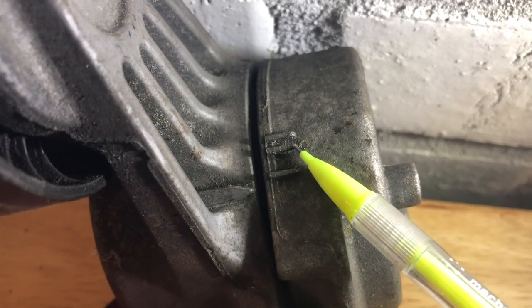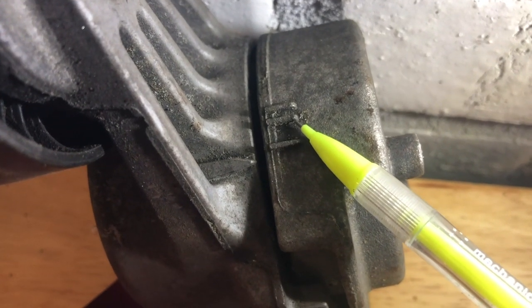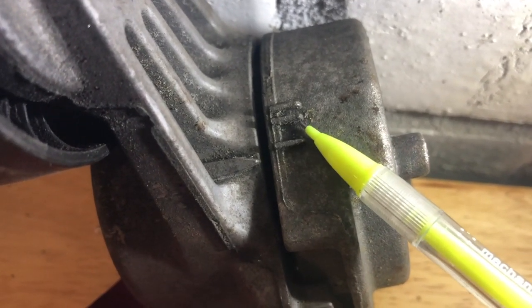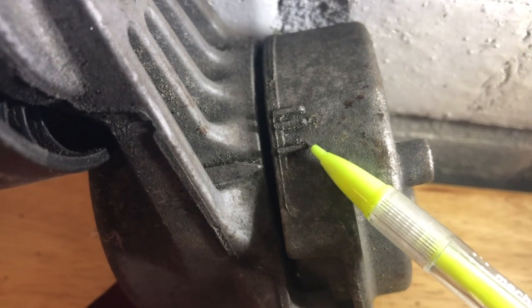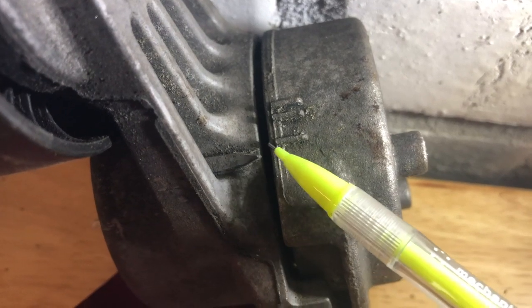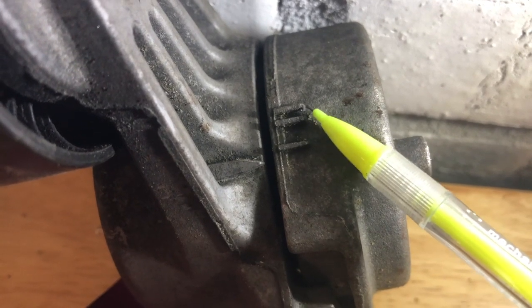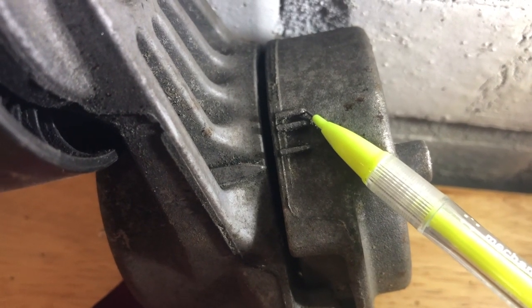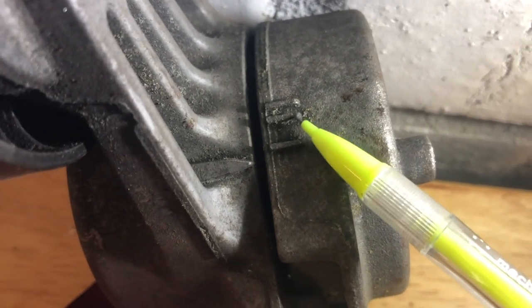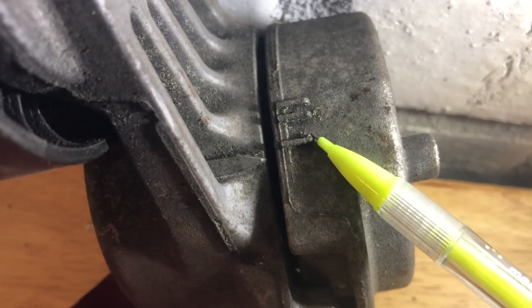When the pointer lines up with the middle marking, that's the 'please change me' marking. As it moves further over to the third mark, it moves from there to there faster — this is saying it's really stretching now. That is the absolute outside limit because the tensioner hasn't got much more travel before it drops the serpentine belt. So basically, you'd like your belt to be between those two close markings. If it's pointing at the middle one you're okay but should consider changing it. If it's in the far gap, get it changed as soon as you can.